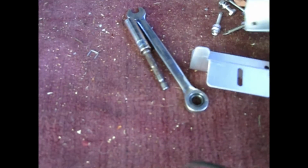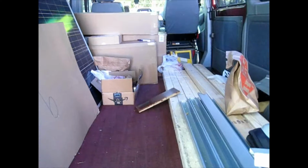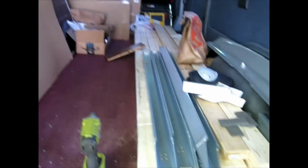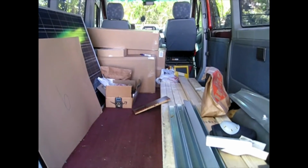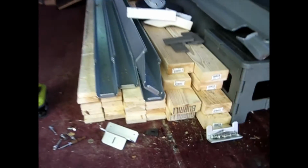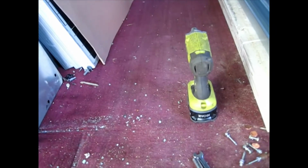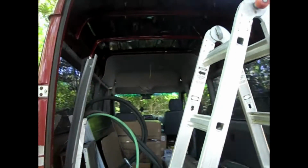So I'm waiting for my butyl tape. I already have the lap caulking over there, they call it Dicor, that's the one. I got the Dicor sitting over there. I also have regular shower and tub caulking, which I'm going to do right now because I expected 15-mile-an-hour wind today. So I need to at least get two of these brackets on. I'll probably do the two in the back here, just to mount it down so the wind don't blow it off the roof, because I already put it up where these things are not light. They gotta be at least 30 or 40 pounds.